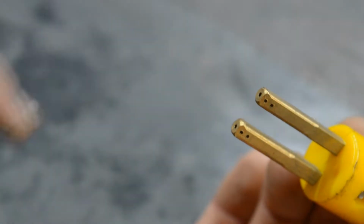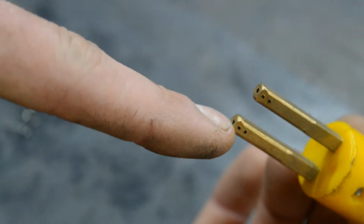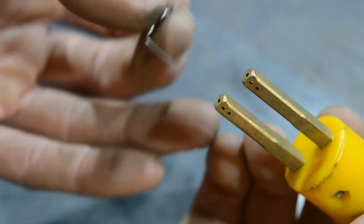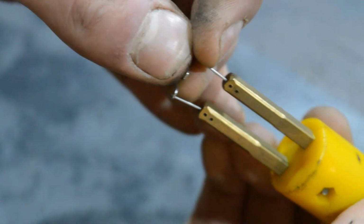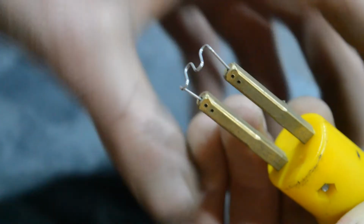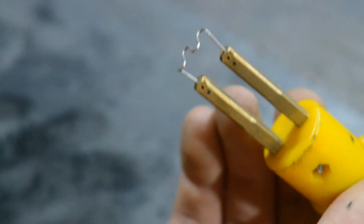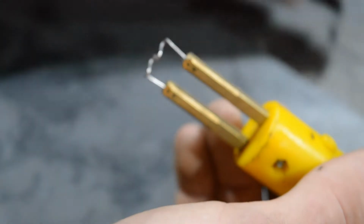So you're going to start with this one. This device here has three holes, one at the side, one diagonally, and one from the front, so that you can reach almost every position. And what you do is you take your staple, put it in here, and then you press this button and hold it, obviously, and then the current that goes through here will heat it, and then you can melt the parts together. It's very durable.